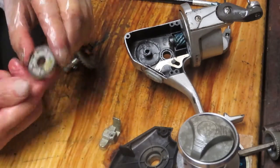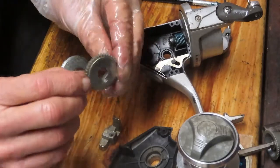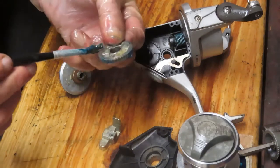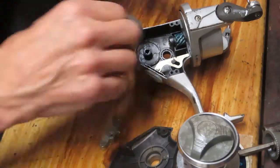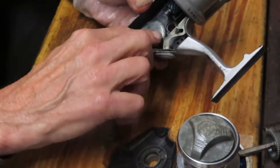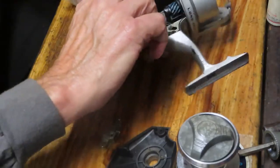All right, let's do the rest of it again. These are clean because it's all dried up. There's only one little pocket of grease there. When you get these, inspect all of the surrounds. Make sure that those teeth are nice and crisp, that there's no grease or dried debris or anything in those channels. When you grease it up, I use an artist's brush. You don't have to get it in every little slice. I know I probably went a little bit overboard based on what I do for the top end there because, well, it hasn't seen it in a long time. I'm going to spin that just to make sure it spins nicely. That's plastic there. I'm going to put a little bit of oil just on the seam, let it work itself in there, kind of work against that case.